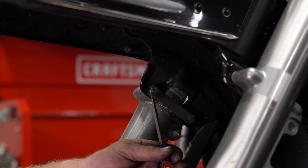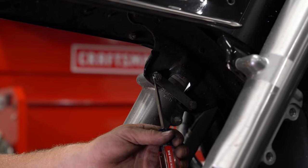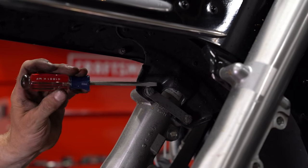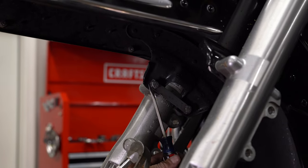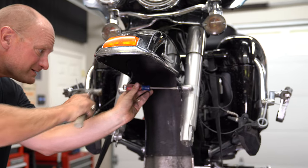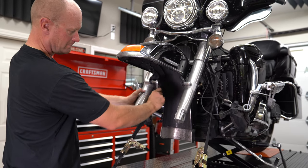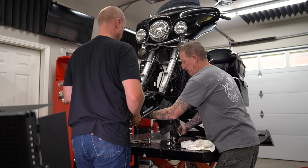To get your front fender off, we're up underneath here and these bolts are basically staked by the metal plate. He's got a screwdriver and a hammer and he's going to bend those tabs out. Once you get it opened up a little bit, he can go ahead and pry it out flat — there are two tabs on each bolt. The easiest way to get these completely flat is to turn your straight slot screwdriver flat and just hit it with a hammer. He's got that one done and we'll go around and do that to all of them. Now with his half inch socket, with those tabs bent back, he can loosen all of these and actually back them all the way out. It will probably take both of us to get the bolts out and then gently set the fender down.